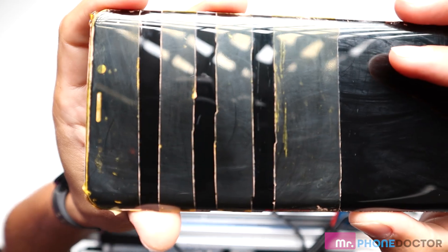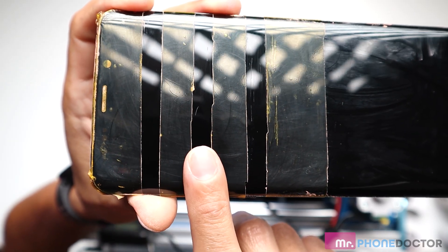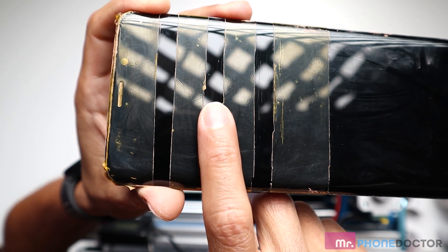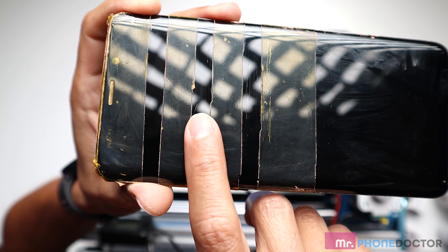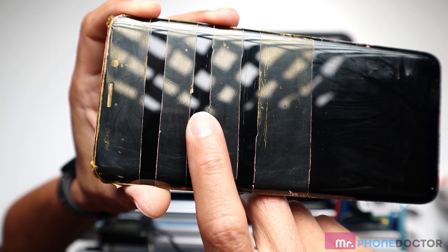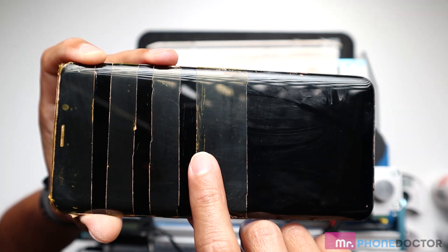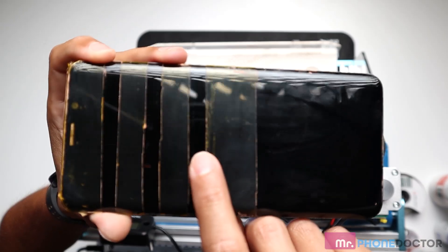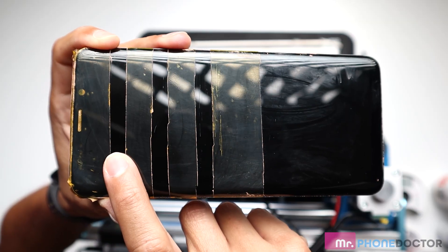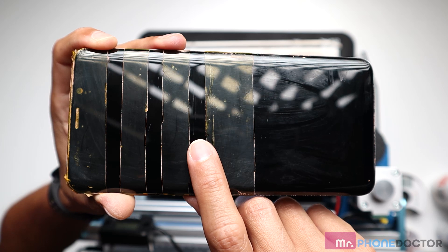Let's get an up-close look at the finished polishing. You can see number six scratches — and here's number seven, and number eight. Number seven, you can still see in the middle there are a few more scratches, and there was one deep one — I may have gone a little too hard with the seven, but that one is actually more like an eight or nine scratch. Majority of the sevens are gone, all of the sixes have disappeared, which is great. Number eight scratches were just too deep — the gouges were too deep for the machine. So six: no problem. Seven: no problem. Eight is where we have issues, but to move up a grade or two is amazing — that saves a lot of time and labor from having to replace the screen.